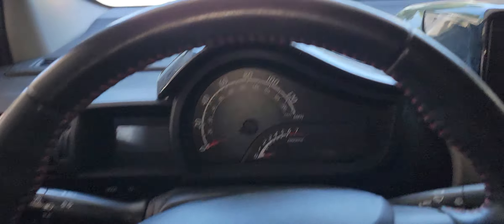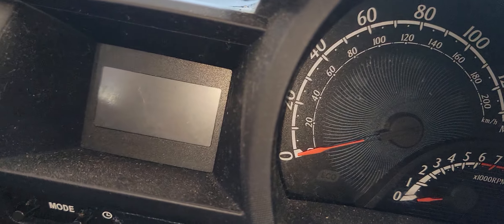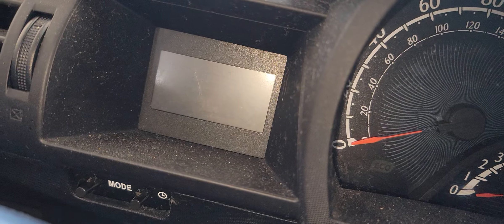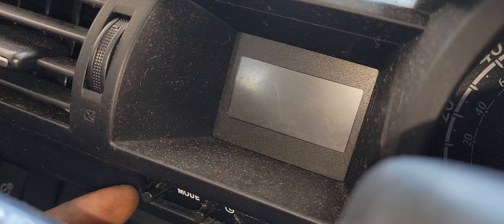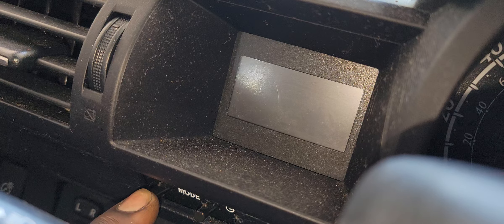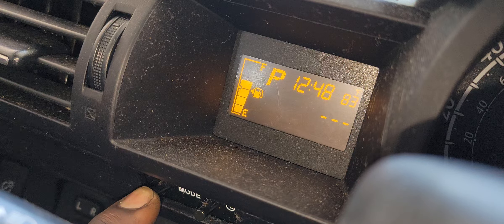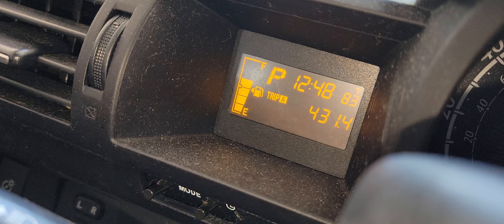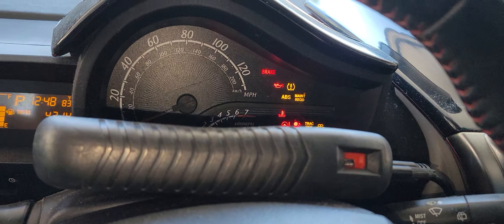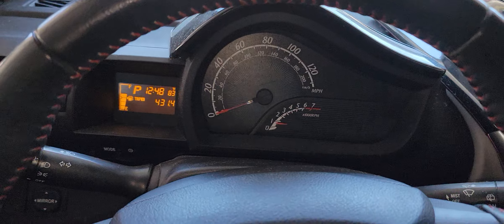While holding this button down, press and hold it, then switch on the ignition — don't start it — and watch those dots. They'll be blinking. Once that's finished, release the button, switch the ignition off, then crank the vehicle and your maintenance light should go off. That's how you reset your maintenance light on a 2012 Toyota Scion.